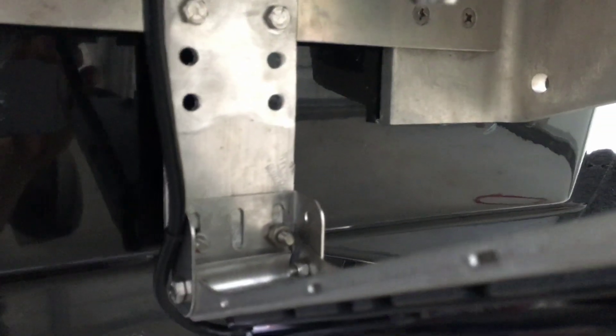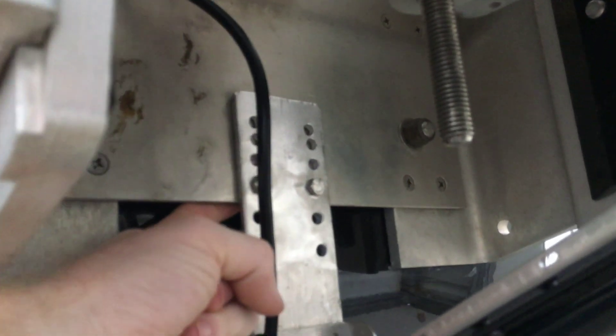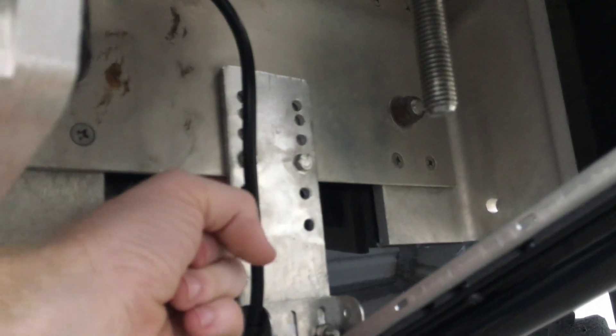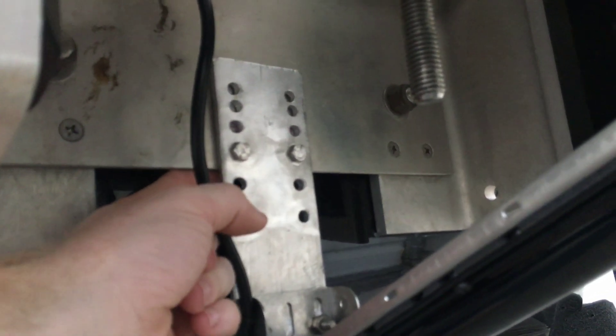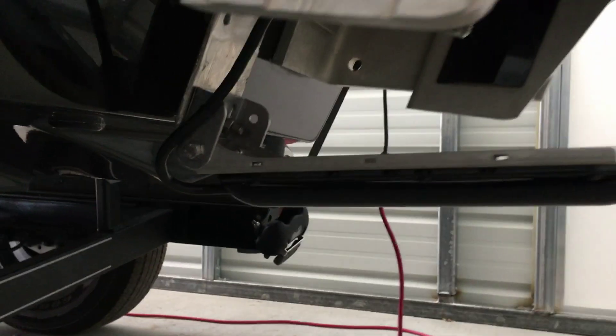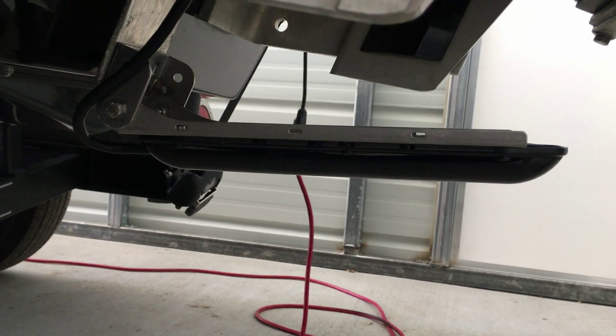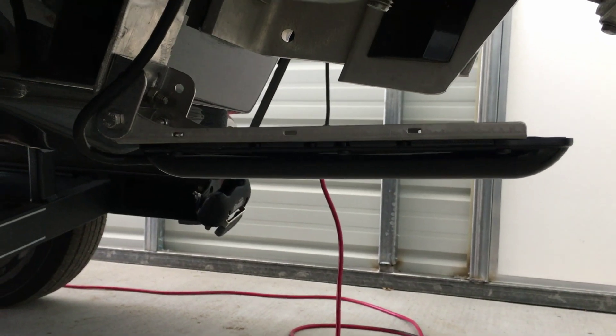So I put multiple settings here, and basically what I did is I just bolted the transducer plate right to that piece of metal. There's a little profile shot of the side — it's hooked to the transducer plate. I used all stainless steel hardware, and I had to make sure that these bolts right here weren't long enough so that when I tighten them down they wouldn't touch the fiberglass. I probably have an eighth of an inch clearance in the back. I mounted the transducer with a slight bend so that when actually powering the boat — the nose tends to rise a little bit — it would make it perfectly perpendicular to the bottom of the water.